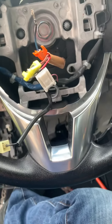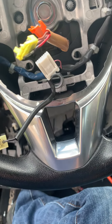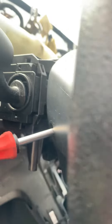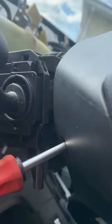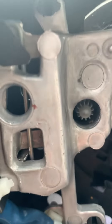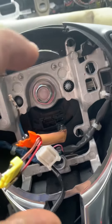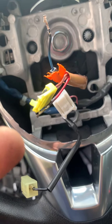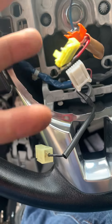It's going to inspection, so it's better to be safe. For these cars, the way to take the airbag out is to just put a screwdriver in — you see right here. There is one here, one there, one there, and then the airbag will come out. So that's how it comes out if your clock spring is okay.